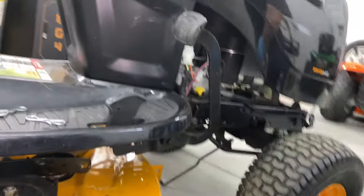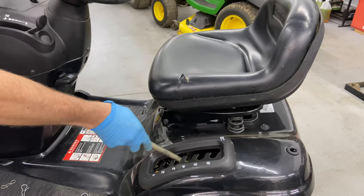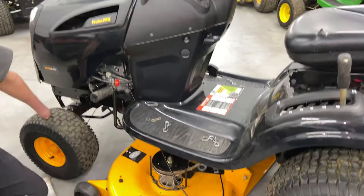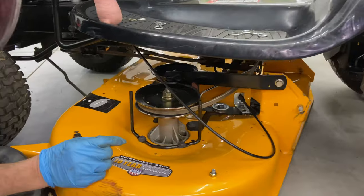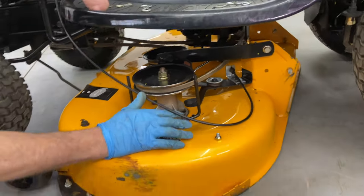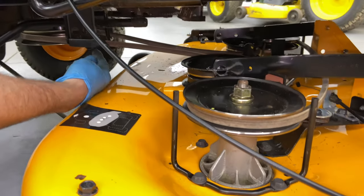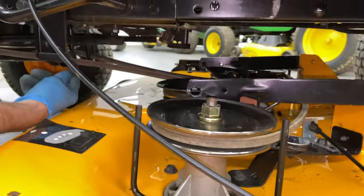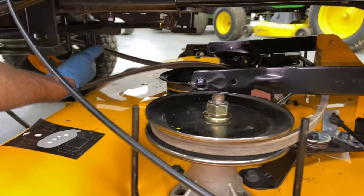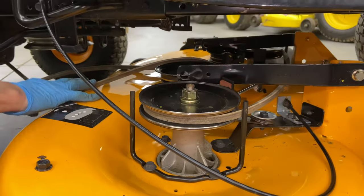We have to go to the other side and put the mower deck in the up position. Be careful — these are normally spring-loaded, so if you let go it'll spring up. Since we have to take the cable off, we're going to slide the deck out. But I did forget one step: make sure you take your belt off the front. There are little U-hangers — you just pick the belt up out of the U-hanger and drop it down to the side. Reach around to the other side, pick it up, and put it down the same way. The belt is now out of the way.